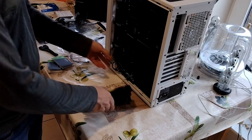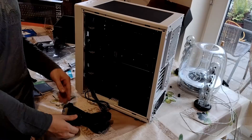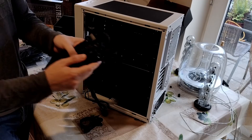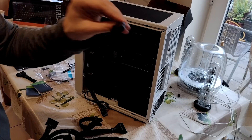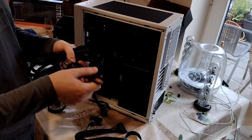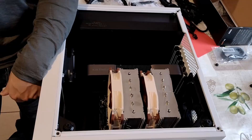Power cable time. We'll probably figure out where all of these go. Some of this stuff connects up to the motherboard, some of this is fan power or IDE power. It's all black so it's kind of hard to see anyway. We've got power cables — we should probably figure out which ones we want. HDD, DVD, SATA, hard drive DVD. ATX main connector, ATX motherboard connector — so that would be that one. That looks to be old school hard drives for the old spinning drives. VGA — these look to be the important ones. We've got VGA3, VGA1. I'm really going to have to read the motherboard manual for a bunch of this stuff. CPU1, CPU2, VGA2 — so we've got VGA1, 2, and 3. This could take a minute.